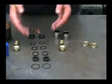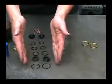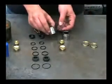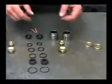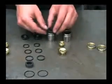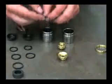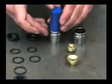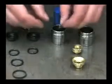Now we can put the sleeves back in and the packings. These are the parts included in the repair kit and one kit will repair the complete pump. Usually what I'll do is build up the part stack ahead of time and then you can just drop them right into the pump. First, put some oil or grease inside of that sleeve, drop your guide down in all the way, then the seal ring — be careful not to crease this. Put a little oil on it, work it in at an angle, and then use that roller.